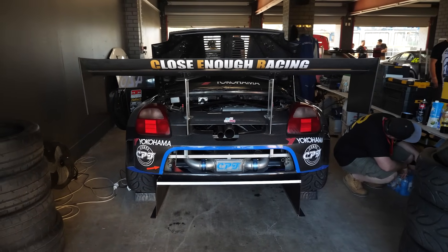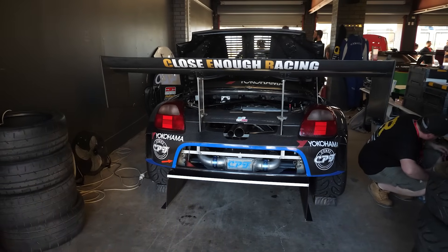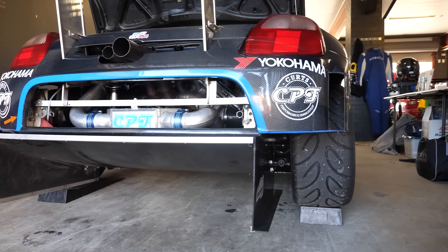We tried different parts and went through a couple of iterations of rear wing that didn't match quite right with the diffuser — stalling air behind it so they wouldn't meet. The new one we've got seems to actually work. We did some testing days in the rain and could see the spray patterns coming off — we were like 'oh cool, it's actually working.' It's a lot of trial and error. If you do the basics and just fiddle with the basics, you can't really go too wrong. There's a lot of off-the-shelf parts — most people aren't going to design their own wing element. Wings will describe whether it's a clean air wing or a 3D wing, tell you if it needs to sit behind a roof structure, and give you basic angles to start with.